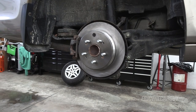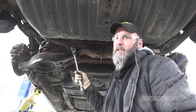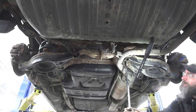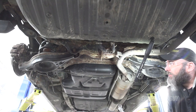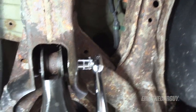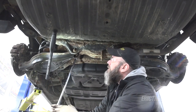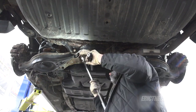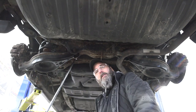With the rear brakes done, let's see if those bolts on the lower control arms move. That's just the outer nut, not the bolt. That one's solid — rusted, literally solid into place. Same thing on the other side. I had hopes, but it looks like the bushing's moving too. I've got to get some control arms, some bolts, and some coil springs for good measure.